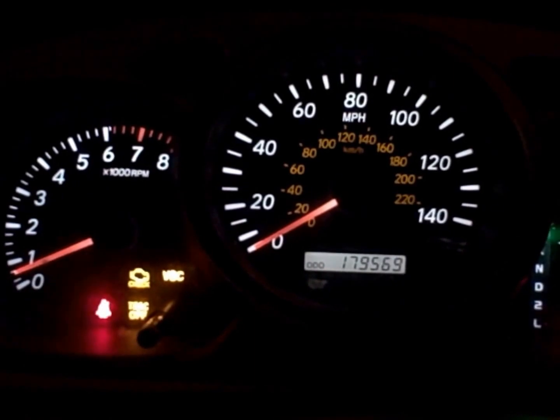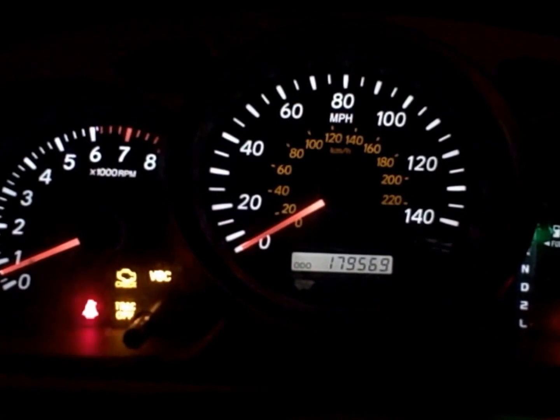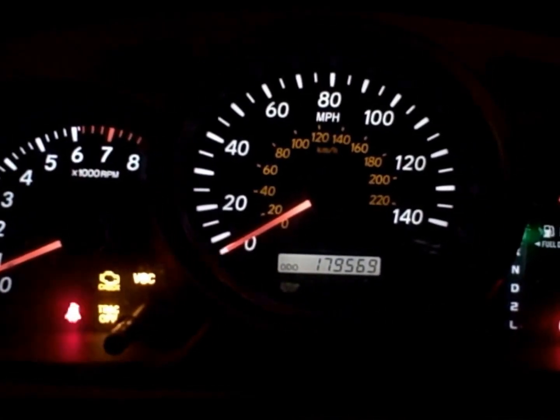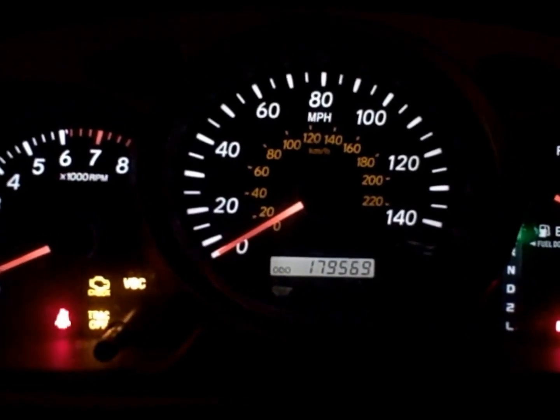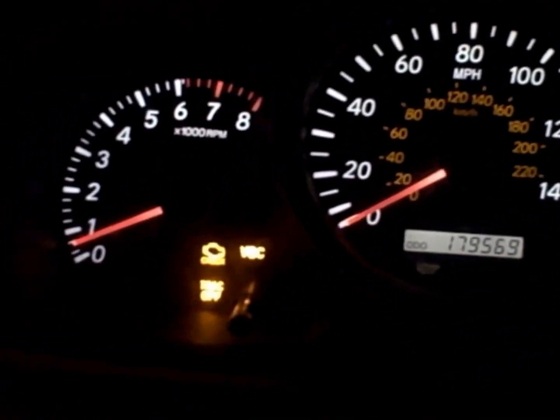After submerging the catalytic converter in dish soap and water for 24 hours, I reinstalled it back in the car, drove the car until the drive cycle completed. However, the check engine light came back with the same code, P0420. We're gonna take the temperature before and after the catalytic converter to see if there's an improvement.